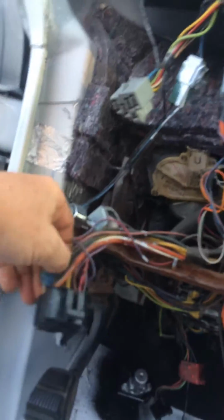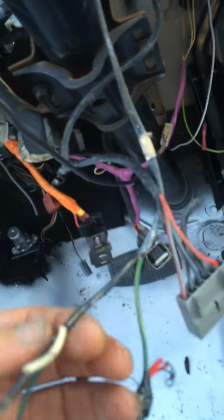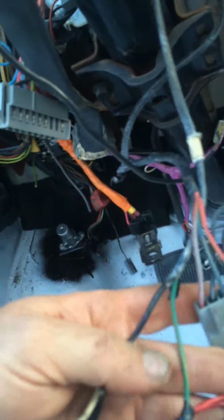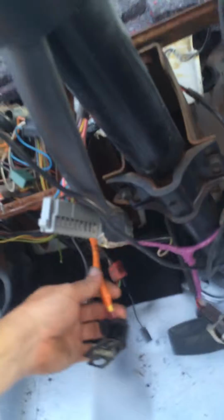But just working my way across through here with the insulation and the black vinyl. Still have all of this wire here to rework, but I don't really see any problems with it. See some connectors that's been messed with, like this, where they've hooked in for accessories. I'm fixing anything that I find like that as I go, and doing new connectors. All this will be taken apart and rewrapped, and again with the color coding.